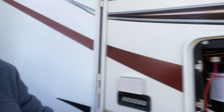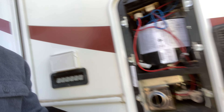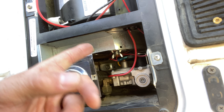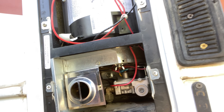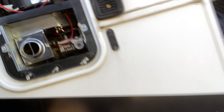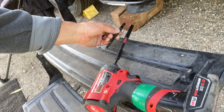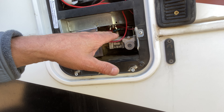I took all of that stuff out. It was full all the way through the vent. Then I did the igniter back in here. Once I took this screw out, this wing nut, pulled out the vent, I was able to get my long screw bit and extend it here and get that flame sensor glow igniter out.